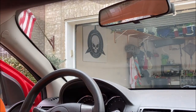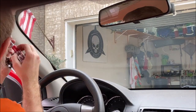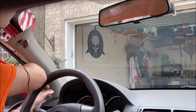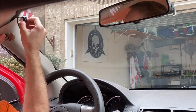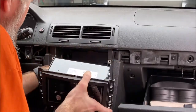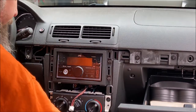With the radio working, it's time to plug in the microphone. I took the trim off the side of the dash and also the trim off the angle piece over the windshield so I can clip the microphone up in that top corner, run the wiring down behind that trim piece into the dash, through the side of the dashboard, and underneath the steering wheel over to the radio. It's just one seven-millimeter connector holding that trim piece in. I fish the cable through, plug it into the back of the radio, and put everything back together the same way I took it apart.